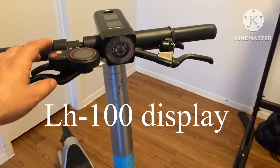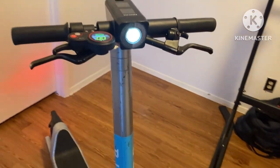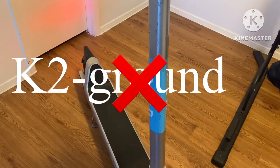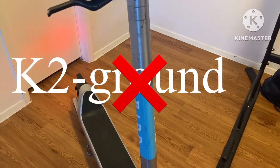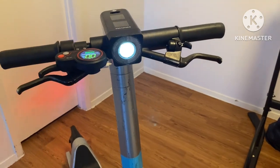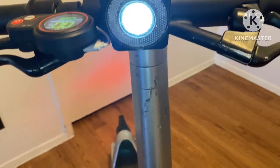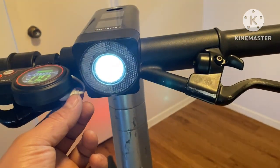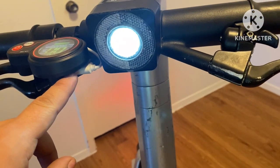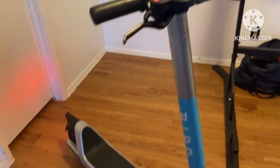Got my scooter done, it's modified. Let's go ahead and start it — hold this down and your display will appear. I want to say really quick that you do not have to go inside this controller to do the bypass. Ground the K2 to activate third speed, or go inside your controller to get the 5-volt supply for your headlight. You can just wire up the controller the way it is — no need to get inside it for any reason. I have my 5-volt supply going to this USB, which you can also use as a charging port to charge your phone.